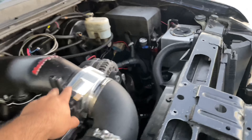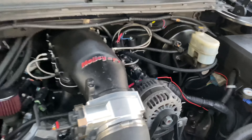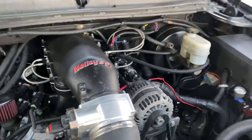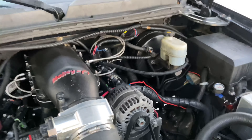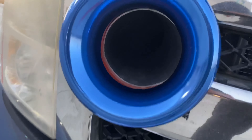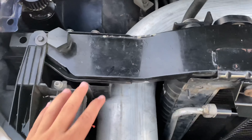I got aftermarket M311 heads. I've been seeing a lot of boosted guys running those heads, but I wanted to try them for all motor. I shaved the heads 45 thousandths to get 65cc's on the heads, which put me up to 11.8 static compression. This throttle body is a 112mm Nick Williams throttle body, which is huge. I ported the Holley intake myself — they come standard 105 millimeters, but I ported it to match the 112. This is a 5-inch intake.